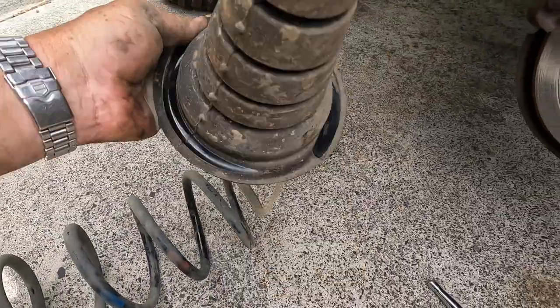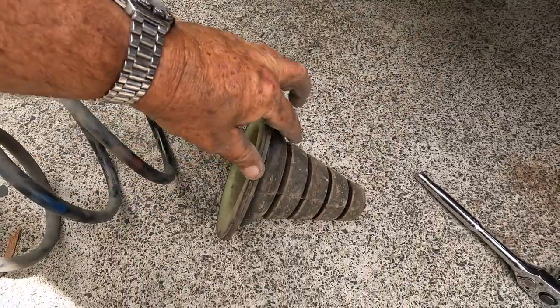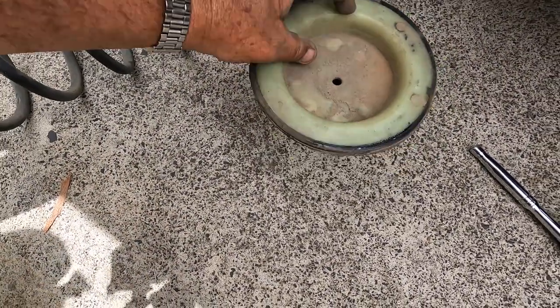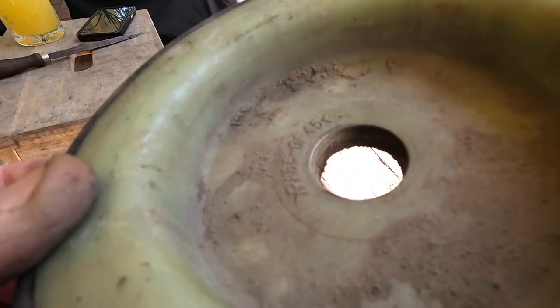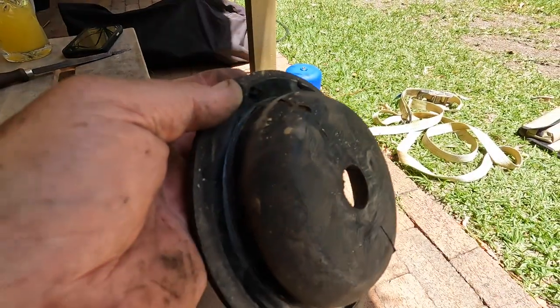With the 200 Series, this rubber bump stopper — we've got to cut it off right in here, so we're going to get the hacksaw for that. Then we're going to drill a hole in here. A hole saw is a good idea, around about 30–35 mil. Just want to make sure that you take the burr off the edge of that plastic so the air hose doesn't get caught up there. Same with the rubber — you can usually hacksaw this off and give it a little grind back.